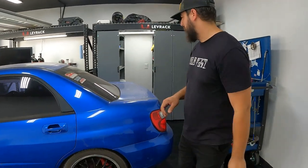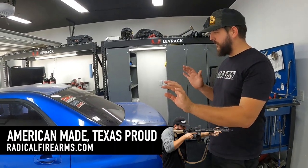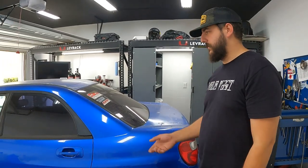I like my clutch disengaging at the very top. That way, as I push in, shift, and catch a gear while releasing, I still don't have the clutch engaged. That's how all my cars are set up, except this one.